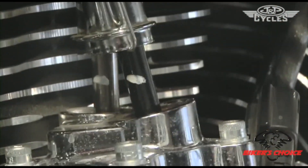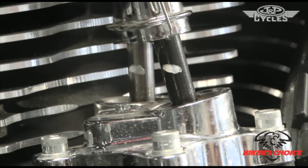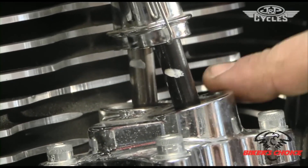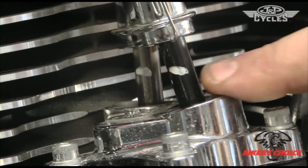Keep them up and out of the way so we can move the push rods. Now what we do is rotate the rear wheel and watch the push rods move. This one's coming down — that would be the intake push rod, and this would be the exhaust.